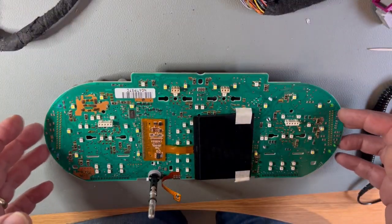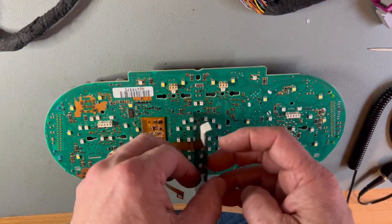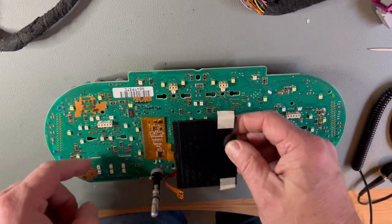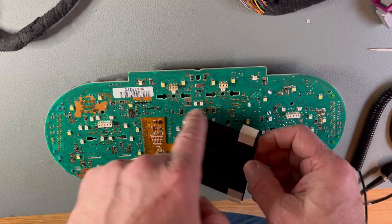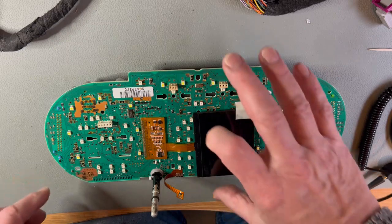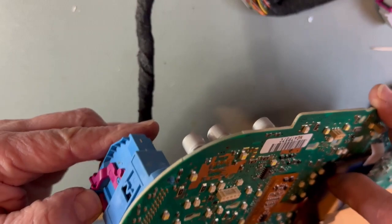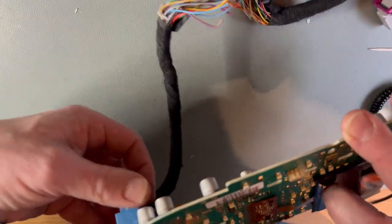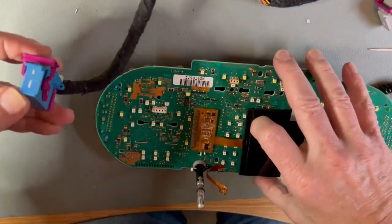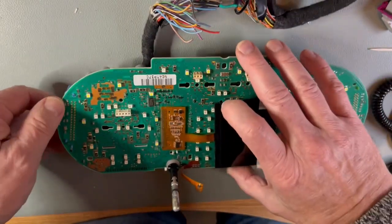Prior to testing the LCD, I'm going to power the board up and make sure that the backlights that sit behind the display are all working correctly. Sometimes these go bad, or more usually bad solder joints around these resistors cause them to flicker. So we always do a test for these joints using a bench cable. Release the clip first to the unlocked position, plug the connector in, slide it straight in, and then pull the lock back.